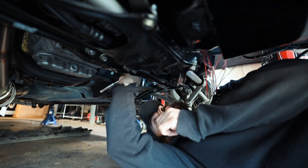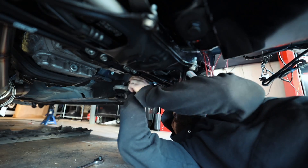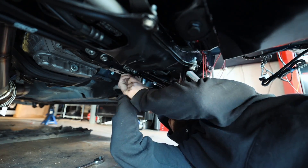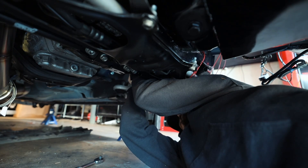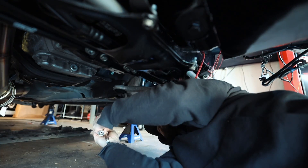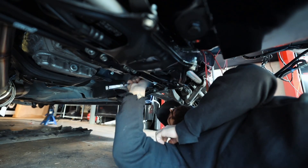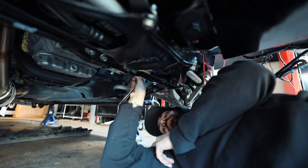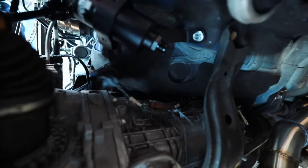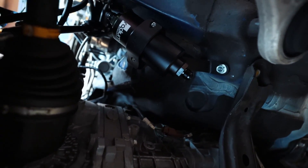Outlet, inlet — there's one broken free, and there's two. I don't think I need to take it all the way out. I think I can just loosen it and slide this guy in and then tighten it. Outlet side is going to face that way. Yeah, you can just totally loosen it and then slide that guy in. You gotta love when parts just beautifully fit and you don't have to cobble stuff together. Fuel filter mounted. Now I just need that dash 8 line to show up — that was quick and easy.